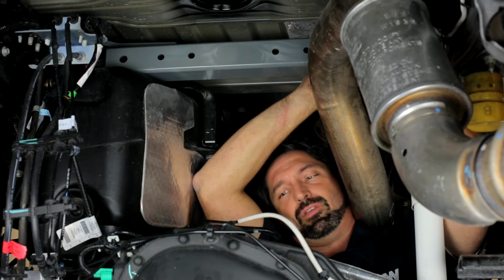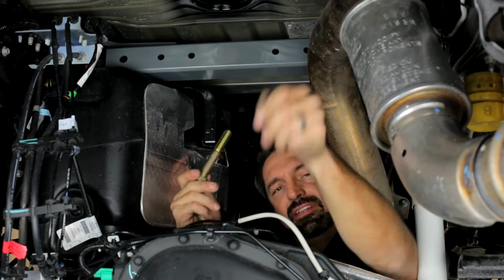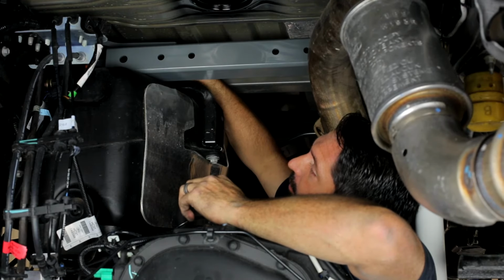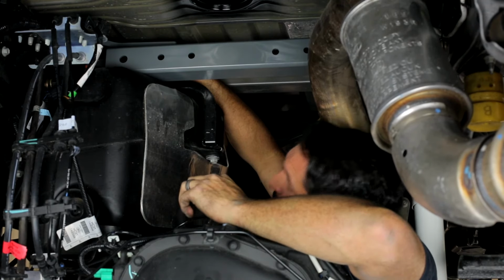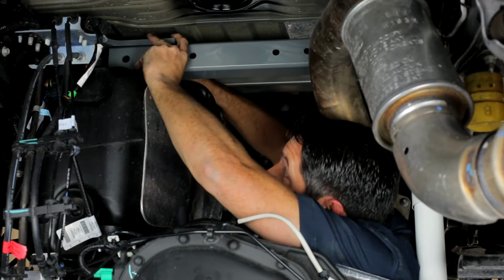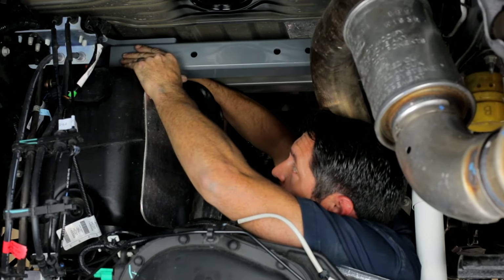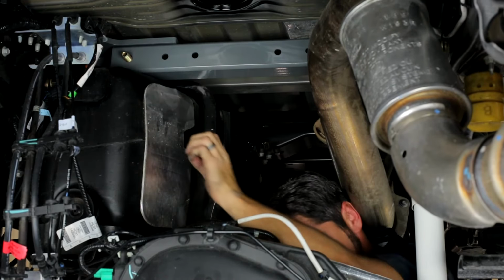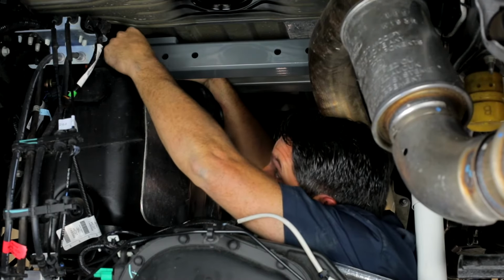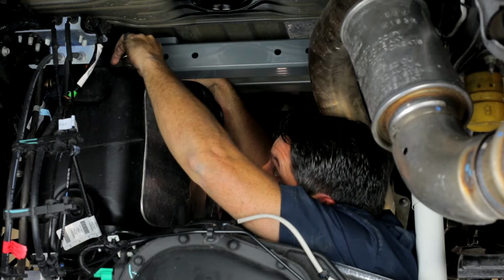Okay. Now we can move over to the driver's side. Those can just be hand tight. Take your remaining 5/8 bolt, 4-inch long, and we're going to insert this in the outermost hole of the driver's side front crossmember bracket and wiggle the front crossmember into position until the bolt lines up with the hole, and then go all the way through both walls of that front crossmember, just like so. Then we'll secure that with a rectangular washer plate, lock washer, and nut.